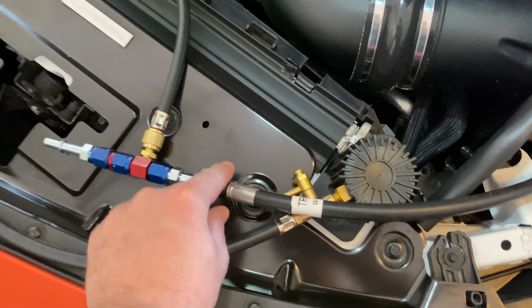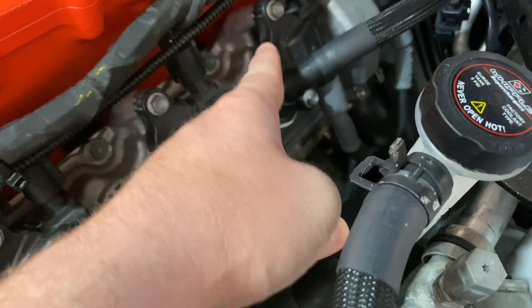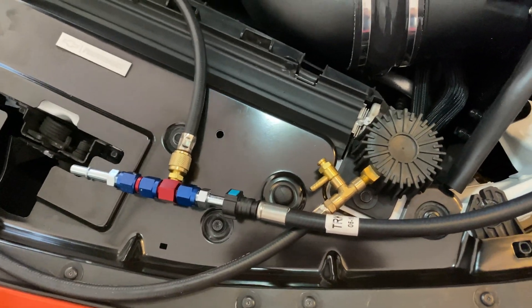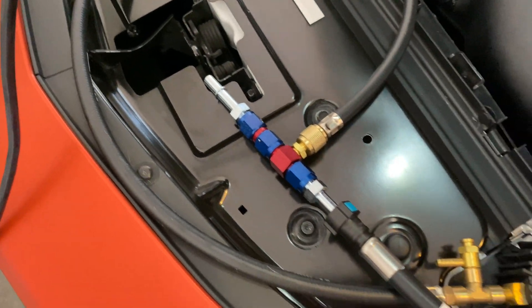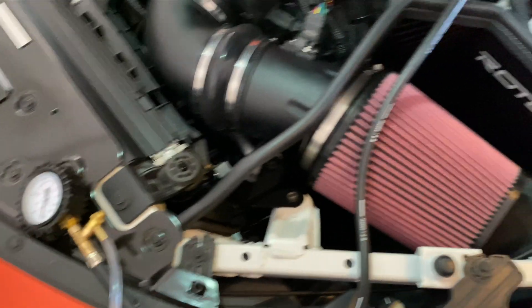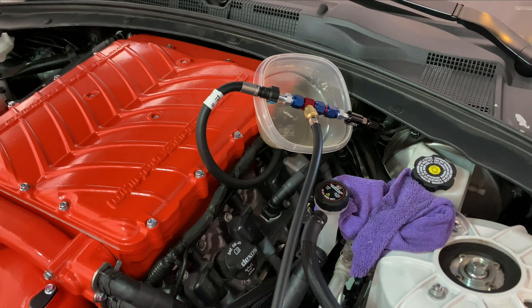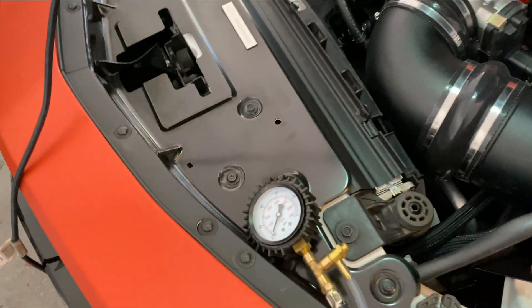So I have my one end connected here, that 90-degree fitting. I'm going to disconnect the fuel line right here and then tap into it using my little concoction. That's going to go on here, and this piece is going to go on my makeshift adapter. I got that vacuum line hooked up there just in case it's spitting fuel out, and I'm ready with the bowl. So that's what it looks like — should work. Test this fuel pressure.